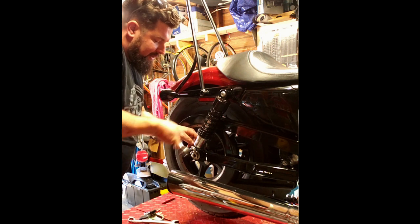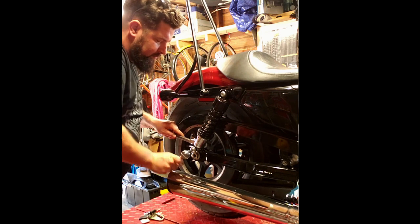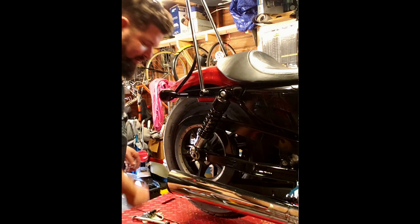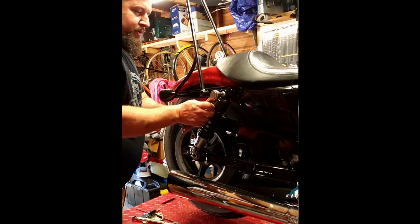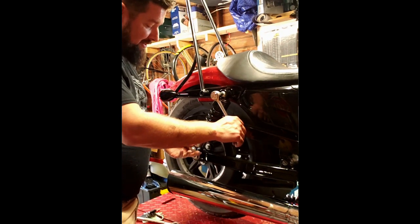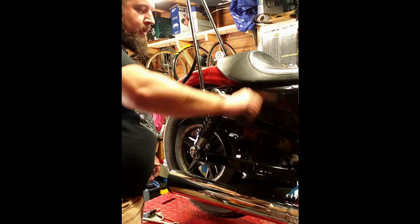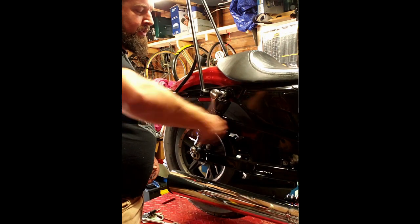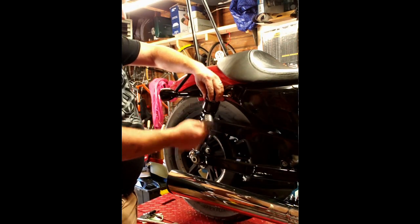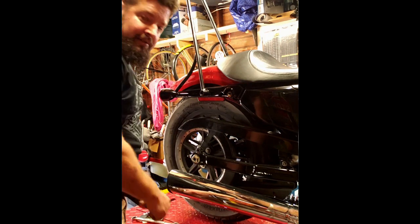Make sure your Torx bit is seated in there all the way. Careful you don't slip off and smash your finger into the muffler, because that would hurt. Alright, we are free. A little bit more here and we'll have the nut off the back side. Now, this nut holds the belt guard on, so be careful that it's going to be a little bit loose. Pull the top one off. Now, before I get any further, it's good to point out that right now this rear swing arm is hanging up by this one shock. So when I pull this thing off, the swing arm is going to drop about a half an inch. Watch your fingers as you pull this thing out of here. Rear shocks are off the bike.